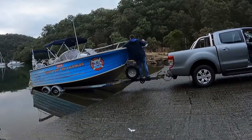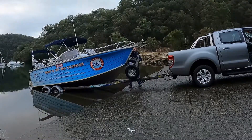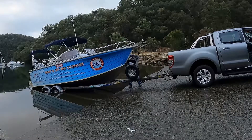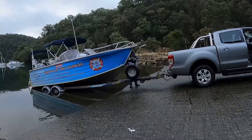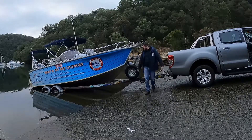So where is my winch handle? There it is. Release a little bit of winch — boat's still not going anywhere, it's stuck on the trailer because it's quite dry and far out of the water. Undo the safety chain and then unclip the winch. Now I can back the boat the rest of the way down so it's deep enough.